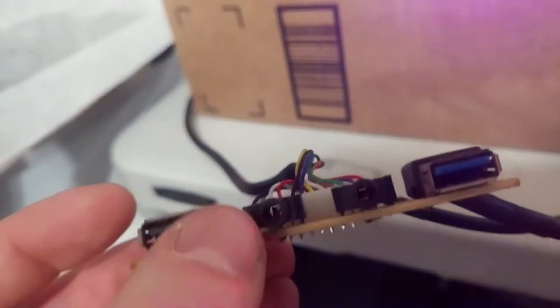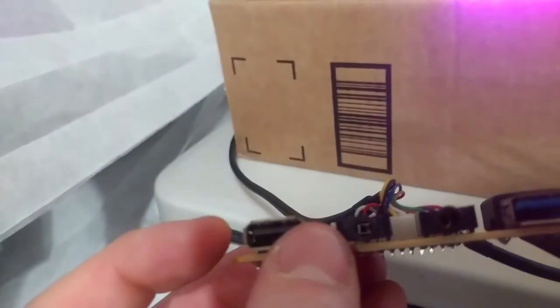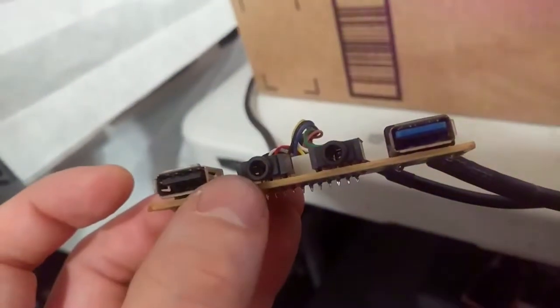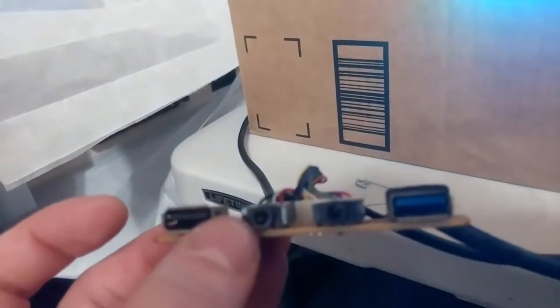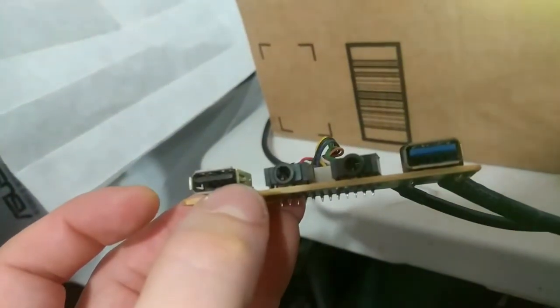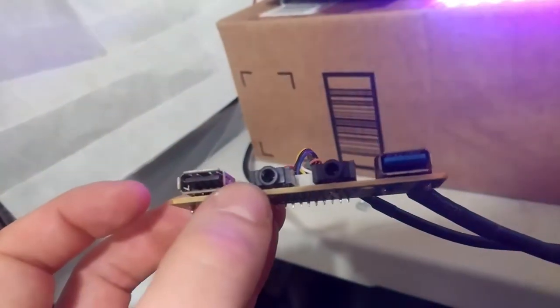It did seem to recognize the headphones right away once I pushed that metal part on the left to the inside, but after disconnecting and reconnecting it started being iffy again. I'm thinking knocking the headphone plug out pushed that clip to the left and it lost its tension. I'm gonna try to push it inwards as far as I can to hopefully regain some of that tension — worst case I break it off.